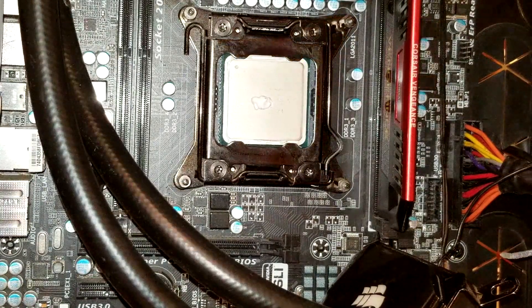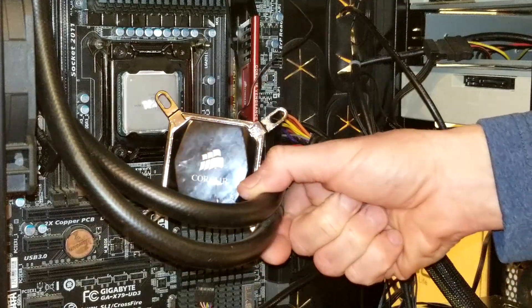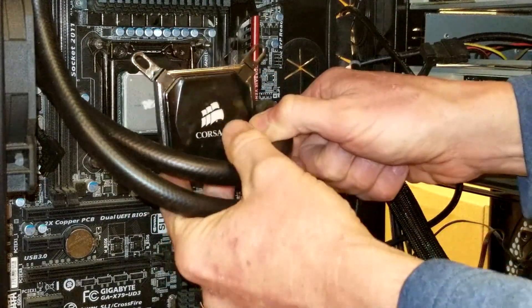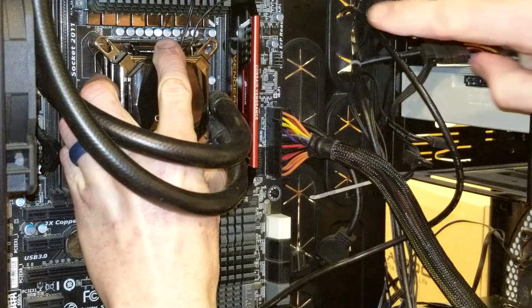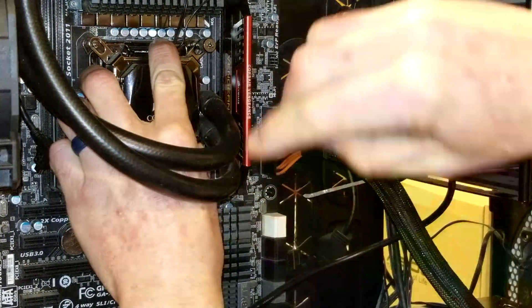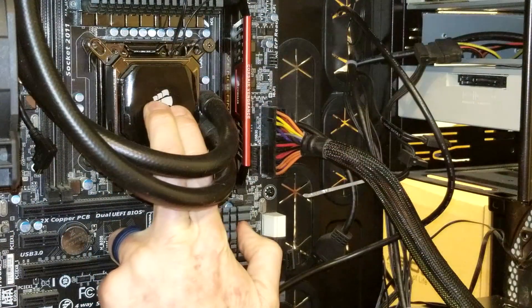Now that the cooler back is clean, we're literally going to put it on as straight as possible. Press the cooler on as evenly as you can, then put on the nuts going in an X-shape — so if you start top right, your next one is bottom left. Press it down evenly first, making sure it slips over the bolt posts, give it nice even pressure, then screw in top right, then bottom left while continuing to hold pressure.